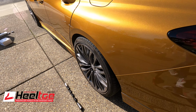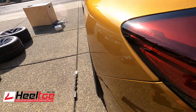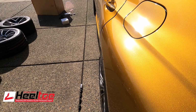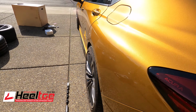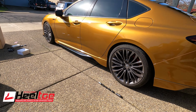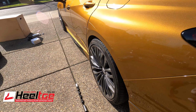The back is sort of similar to the front, and you can find that the tire does come out quite a bit farther than the original one does. 25mm spacer is quite a bit, but it still fits inside the fender. There won't be any rubbing with this fitment at all. So keep in mind that even though this is aggressive looking, it actually looks really great on the car, really complements the look. There really isn't any drawback to running spacers like this.